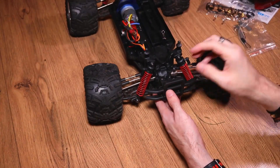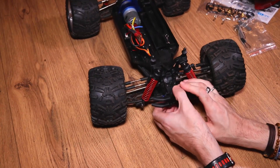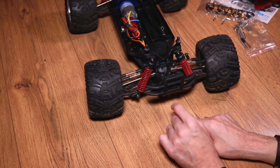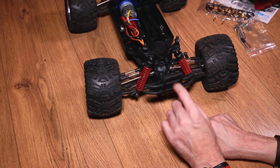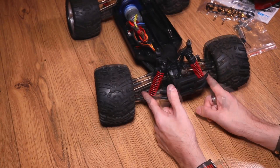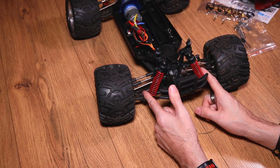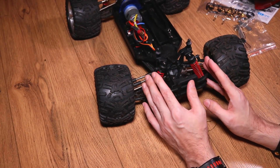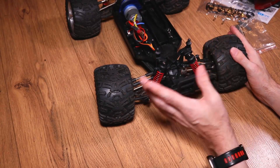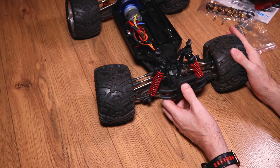The main shock towers are adjustable, but they're not oil-filled shocks — they are spring loaded. You can see them springing back into place, but they do the job rather well. You have all-metal steering linkage, dog bones, differential cups, axle cups and so on — everything is metal. And behind the wheel you have metal hex nuts with metal pins, and front and rear bearings, which is great.